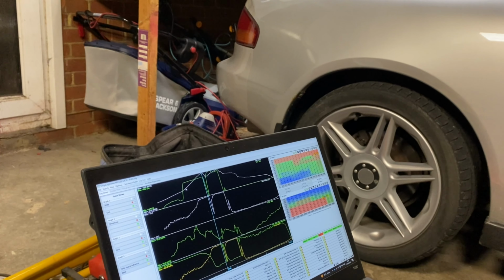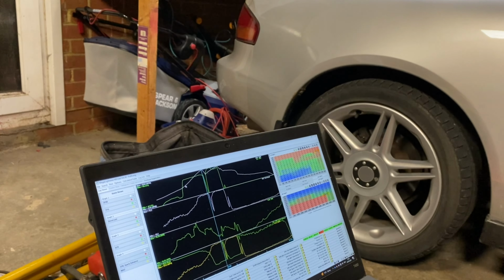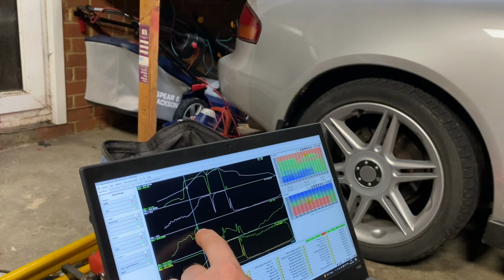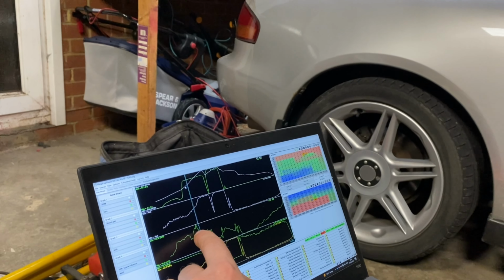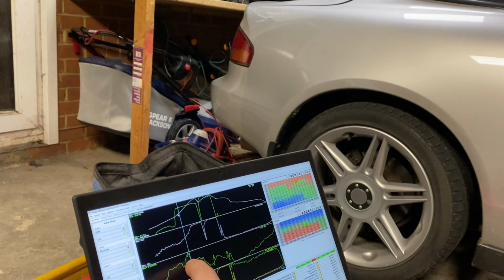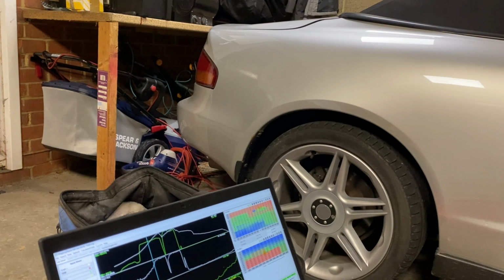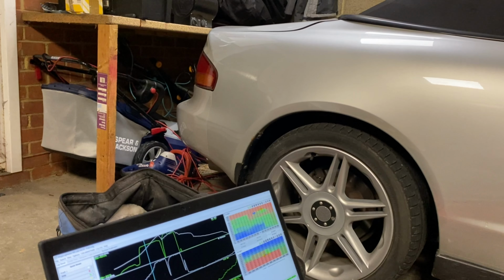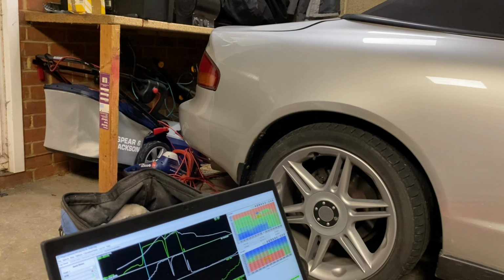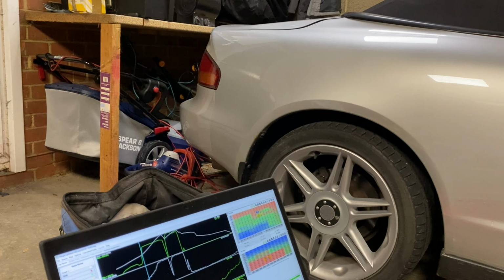You've got cells on the right-hand side, haven't you? If you watch where our lean spot was, as we transition, that's in that batch of six cells. It went lean as it came on to boost. What's that number there, that cell? Was that still 50? So we've got 57, 52, 62 in there. That whole range there probably wants to fatten up a little bit. I did put that all up to 62. From the last burn, it should be on 62.